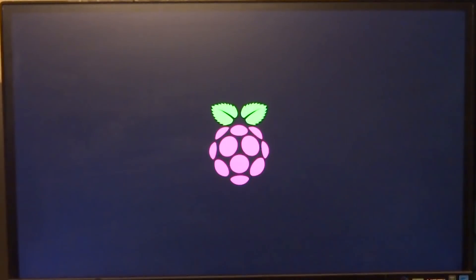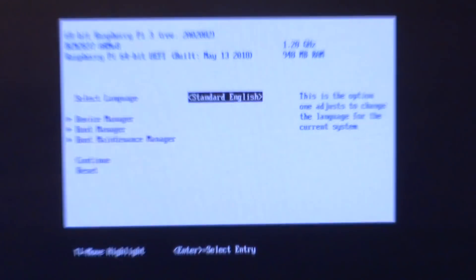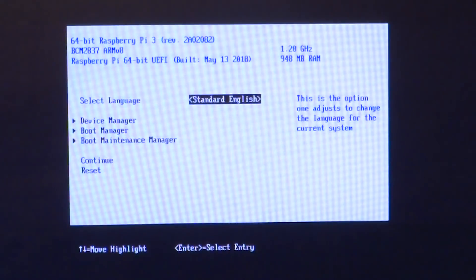At the end of the day, it's not really about messing with Windows 10 itself — it all boils down to that UEFI bootloader that Andrew wrote and made run on the Raspberry Pi. That UEFI bootloader is fairly close to ACPI standards, just enough to make the Raspberry Pi 3 work properly with Windows 10. That's where the majority of the work has gone. That's your proper UEFI loader that you'd find on most computer systems.